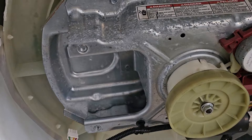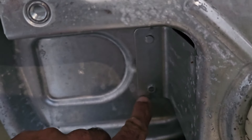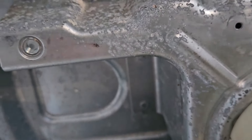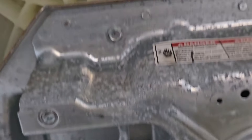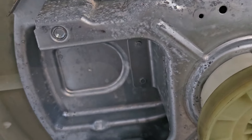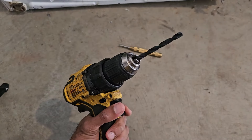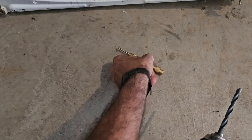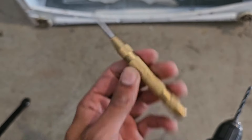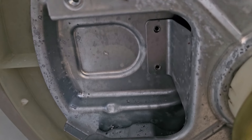What we're going to do is actually drill out these two rivets right here — one there and one there. You don't have to worry about piercing the tub because there's a quite large gap between the transmission and the tub, so as long as you're not too aggressive when drilling, you won't pierce the tub. I use a quarter-inch bit, and before I drilled I made a center punch hole. With a quarter-inch bit it drills out quite nicely.